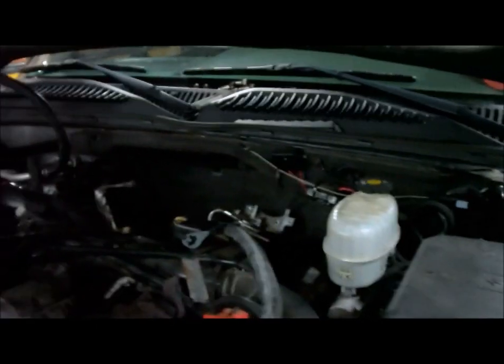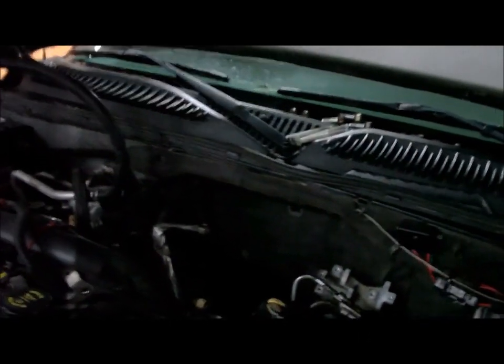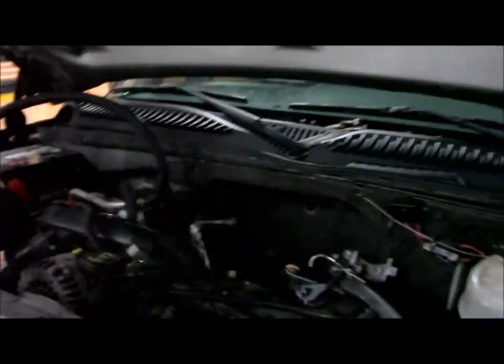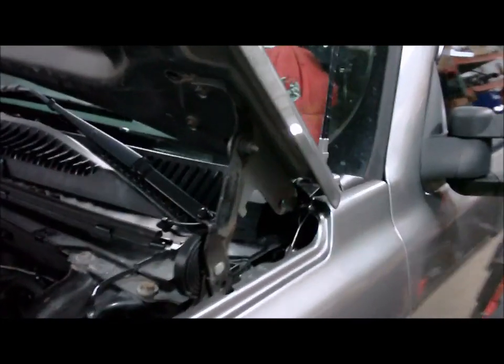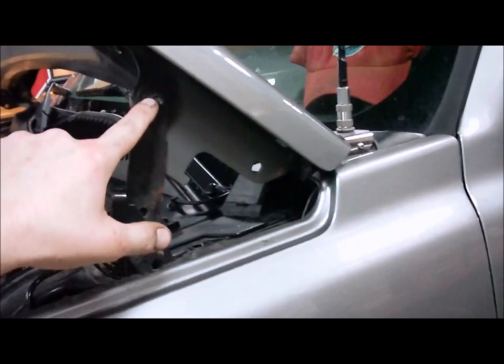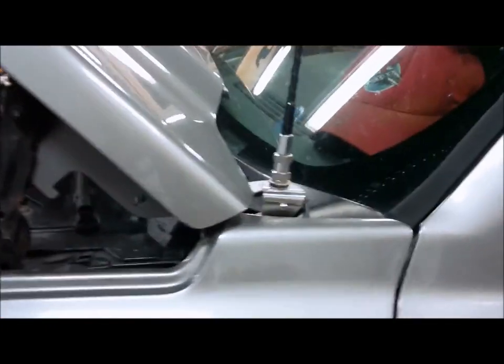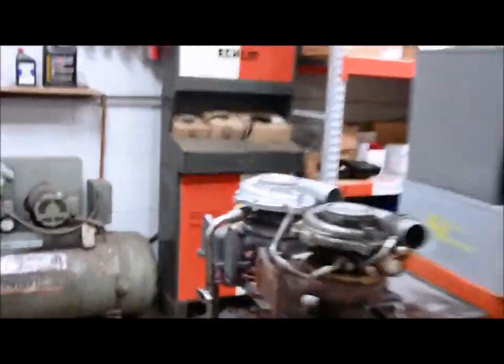What I was told is the factory calls for removal of the transmission or the cab to get the turbo out, which I think is ridiculous. Another thing you can do is put your hood in the maintenance position and take this bolt out, lift your hood up and put it here. But my CB antenna mount is in the way and I didn't really care to, so I just left it. Well, see you in the next segment.